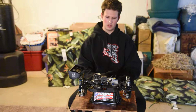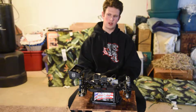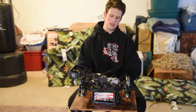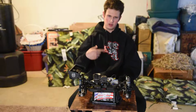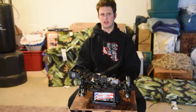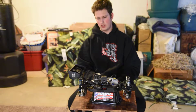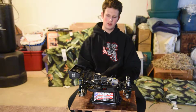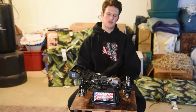I have a Buku clutch hookup to it with a Kyosho vented bell clutch. The good thing about a vented bell clutch is that if you're running a long main or something like that, it keeps your power band from slipping, as in the clutch. It doesn't overheat and then start slipping. It gets well vented, just to cool it down and make it more responsive at the longer mains, like a 45-minute to an hour-long main. You don't want your clutch shoes overheating and have a huge problem.